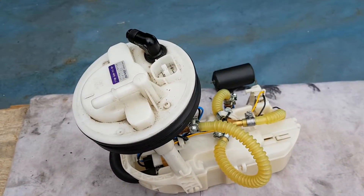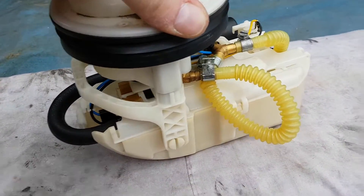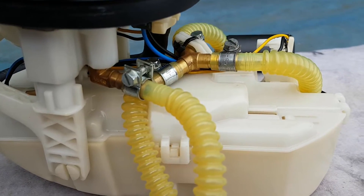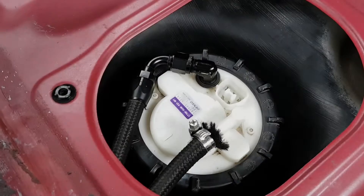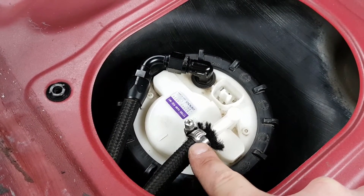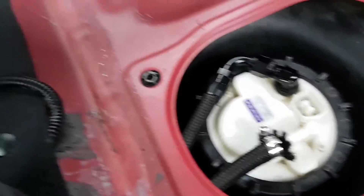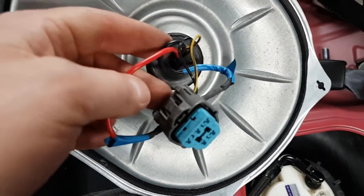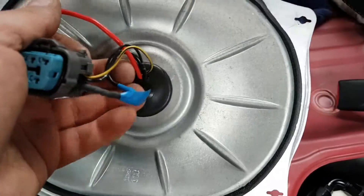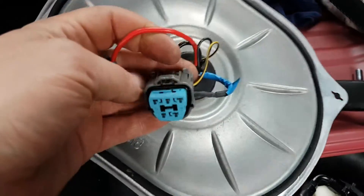It's all back together again, everything back in its place. I've added an additional cable tie in there for security. If you decide to do a return fuel system, make sure you remember that this gets pushed down onto these stops here, so all your cables and fuel line plumbing need to clear — which is exactly why I'm using a 90-degree fitting here. This is what it looks like in the car: this is the feed to the rail and this is the return, jubilee clipped on — the AN6 hose fits nicely, never had a leak. I also rewired the plug: the black and yellow wires are the fuel sender, and the red and black wires run all the way from the fuse box at the front of the car with a relay in the middle, basically getting as much voltage to the pump as possible.